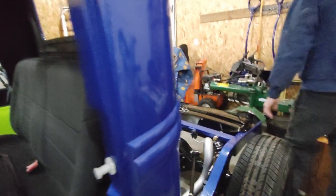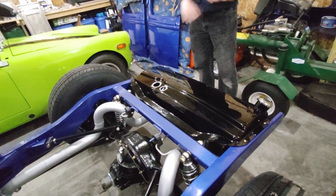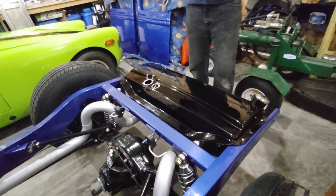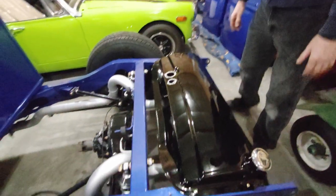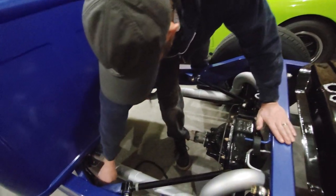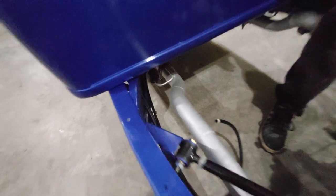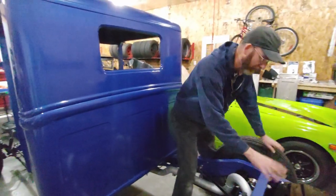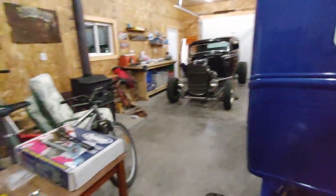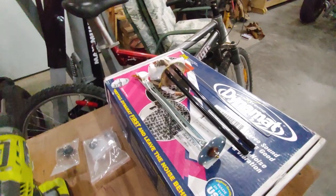In the back I painted the gas tank - as you saw in another episode there was a little bodywork on it, so I cleaned it all up, epoxy primed it, and put a nice coat of black paint onto it. I thought the black and the blue would go well together. Once the box is on it you're not going to see it anyway. The fuel line came in on Friday - I ordered it from Amazon, it's a braided steel line, but I've got to go buy some fittings to attach it to the frame and plumb it up to the gas tank. Right behind the camera there is the fuel tank pickup and the fuel tank sending unit, which will also have to be fitted in the gas tank.